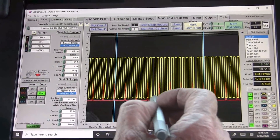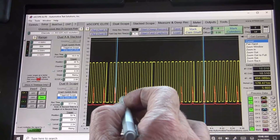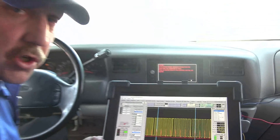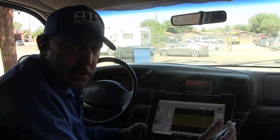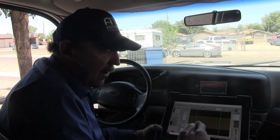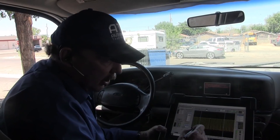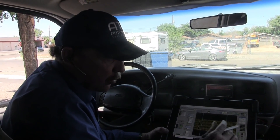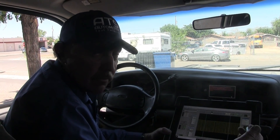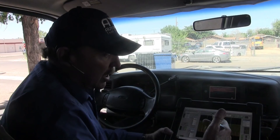When I put these up, do you see all those are in the troughs of each one of these? That's the target point that the computer is programmed to fire these. Now one of the things I want you guys to be really careful of on these 7.3s: the cam signal magnetic intensity gets bad on these and it makes these fire in the wrong place. So it will look like they're still in the troughs — it looks right on the cam — but the cam where it made that magnetic change and changed the voltage is now not in relation to the engine. It's out of relation and these engines will run really bad and they can knock too.